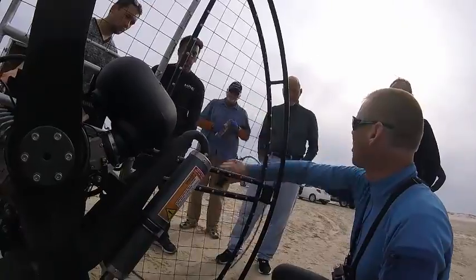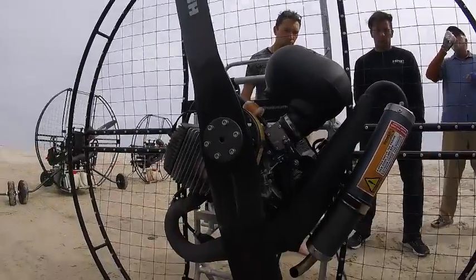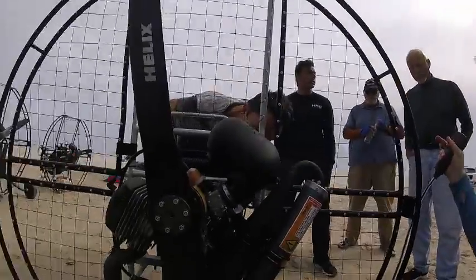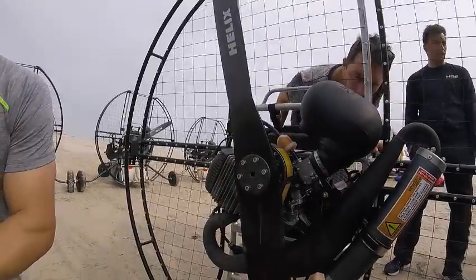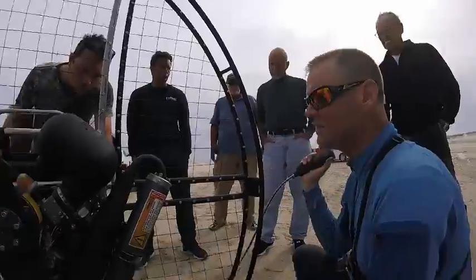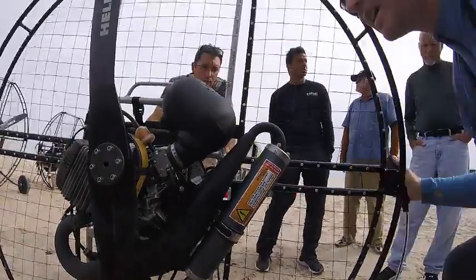So if you notice your RPMs are changing when you move your throttle cable, you want to go in there and put just a teeny smidgen bit of slack in it. So there's just enough so it's nice and purdy. You don't want it super tight because, you know what I mean? Correct. And then you got 2,000 RPM instead. Bingo. Good point. There you go. And then of course you got the kill switch.